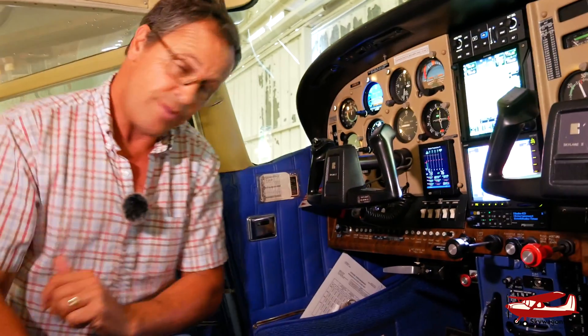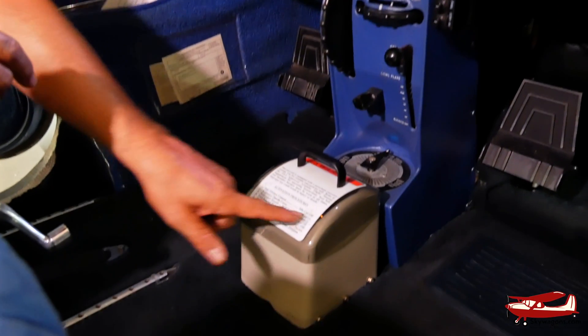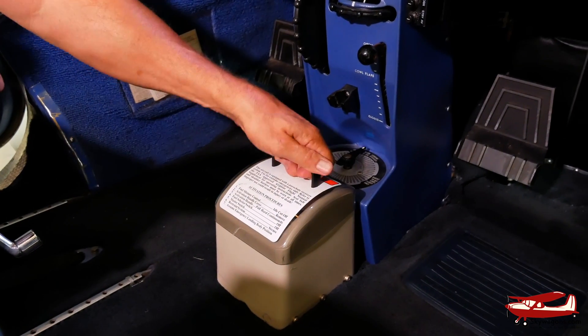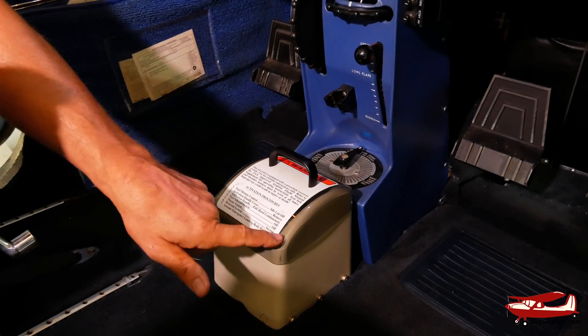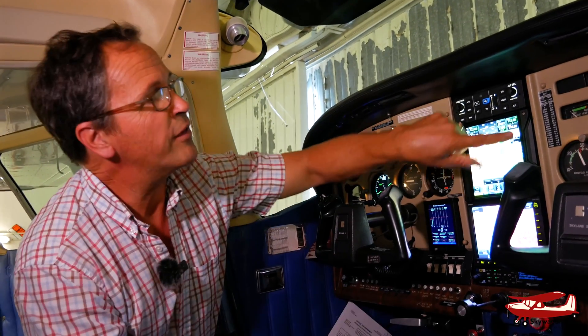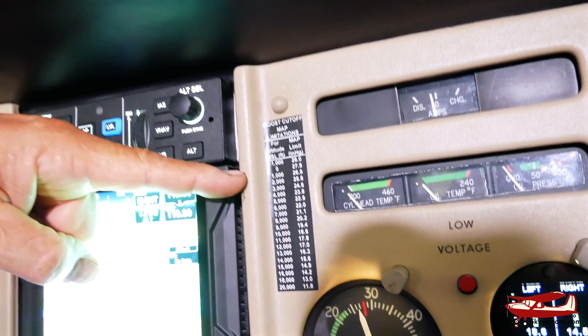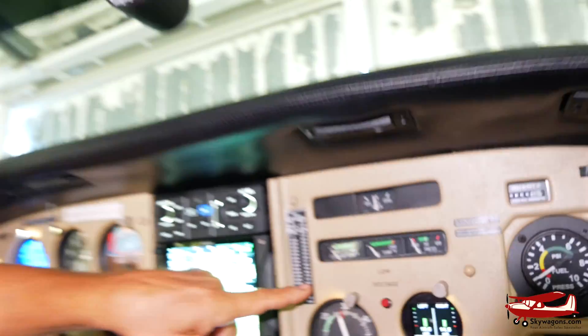For the BRS ballistic parachute activation procedure: turn off the mixture, rip the handle cover off — it just lifts off — then turn off the master switch and pull the chute at 130 knots. It'll blow the parachute out the back. Inside there's also the supercharger boost cutoff manifold pressure limitations chart. You choose your altitude and read the manifold pressure available with or without the supercharger engaged, keeping you on track with power settings.